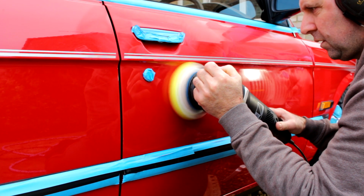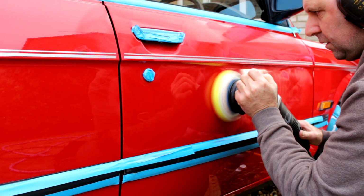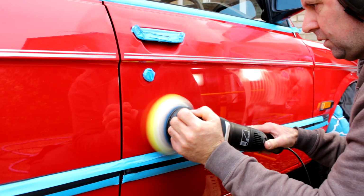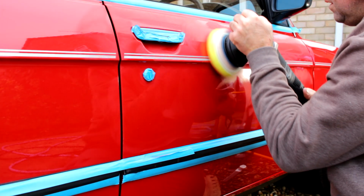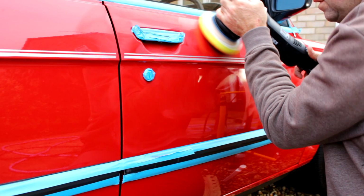So with the amazing masking up I've done there, you can tell who does the wrapping in my house. Not. Cast your eyes to the right of the panel. Yes, I put a little bit too much on the pad when I was priming it and I had to spread it out the entire length of the door. Wouldn't normally do this, it was me getting a bit carried away. So just do small sections at a time.